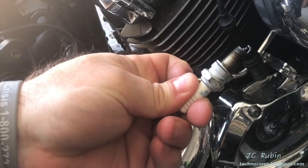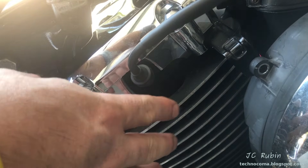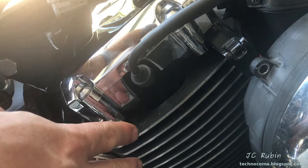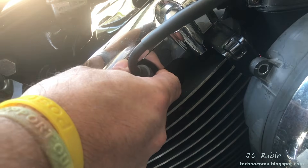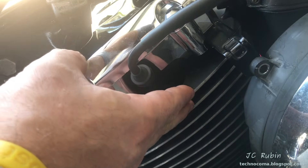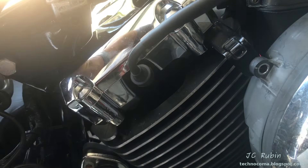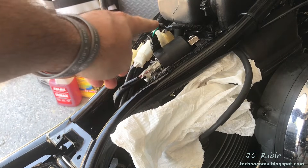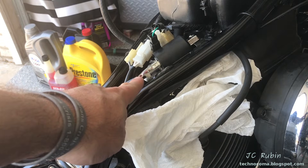Sometimes it's just fouled plugs. I'm going to put this plug back in now. At this point, if you're getting spark on the spark plug test or the other test and you realize your ignition is probably fine, you probably have a problem somewhere else. But at least you didn't waste your money or time on a new ignition for no reason. So start putting your focus somewhere else — now that you've ruled out ignition, you could go to fuel, air, or compression. I hope you found this video on the Yamaha ignition system troubleshooting and repair enjoyable, entertaining, informative, and helpful.